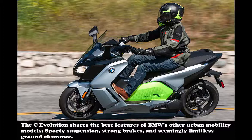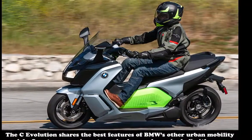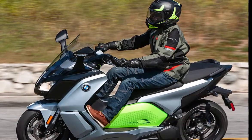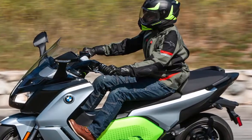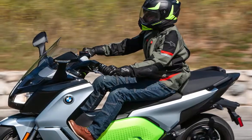Since I have a level 2 charging station at my house, I was able to verify that BMW's claims of over 9 hours on a 110V outlet and half that on a 220V charging station were accurate. I also attempted the unfair test I apply to every e-motorcycle I review — a ride in the mountains involving a short highway trip and extended uphill sections on winding mountain roads, meaning lots of acceleration and deceleration. I make the turnaround when the battery reaches 40%. Although the C-Evolution didn't make it to my goal, it made it farther than any other electric bike I'd tested, and I was able to make it back home on that 40% charge after a round trip of around 40-50 miles.